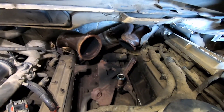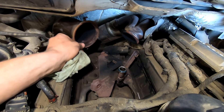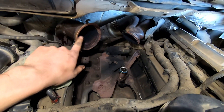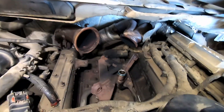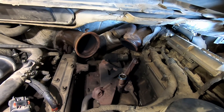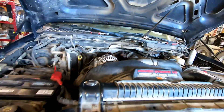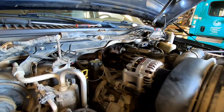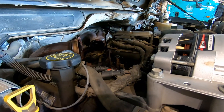Drain's back in. Sometimes it's good to get someone underneath the truck to hold the down pipe — it can get hung up on the turbo. Go gentle, go slow. Make sure you get over to this side before it's all the way down, and watch that drain to make sure it's lined up properly.